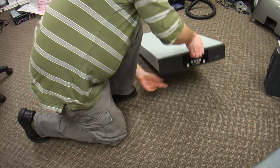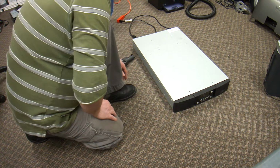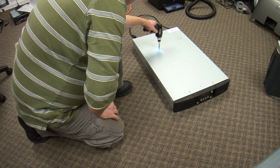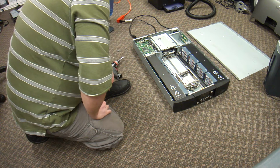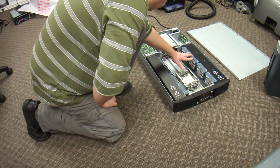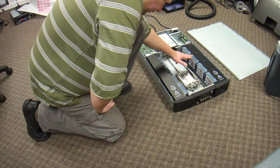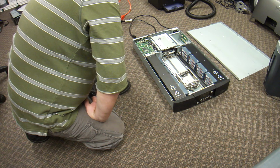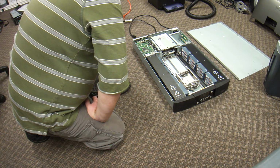Exabyte tape drive. It's an autoloader, which means there's a robotic arm inside and a bunch of tapes. So I'll pull the last screw out. Wow. So it has 12 tapes on each side, so 24 tapes at 400 uncompressed, 800 compressed, which adds up to less than 20 terabytes of data that can be stored this way.